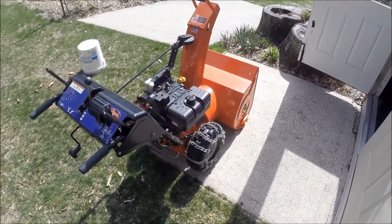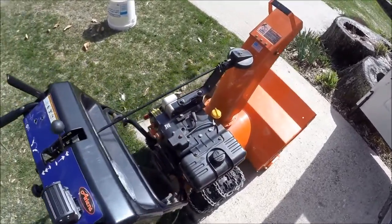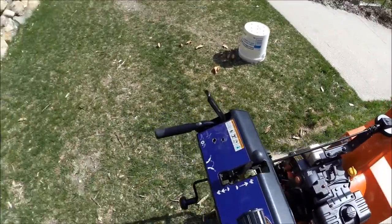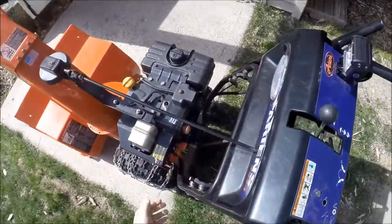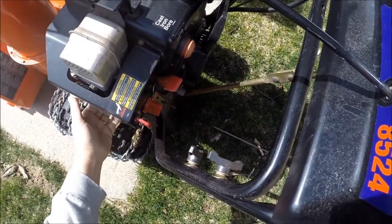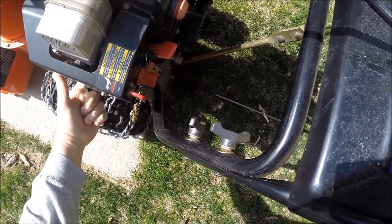When you're putting your snow blower away for the season, completely empty out the gas can. Empty it completely, then run the engine until it completely runs out. Underneath where the carburetor is there's a button and it should let out any fuel that's left in there.